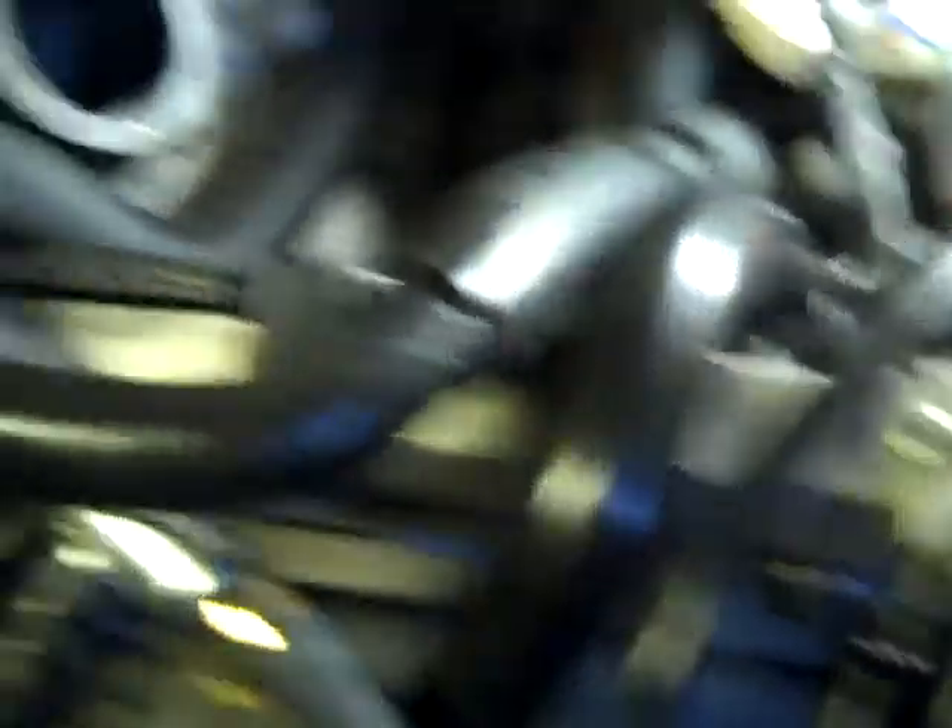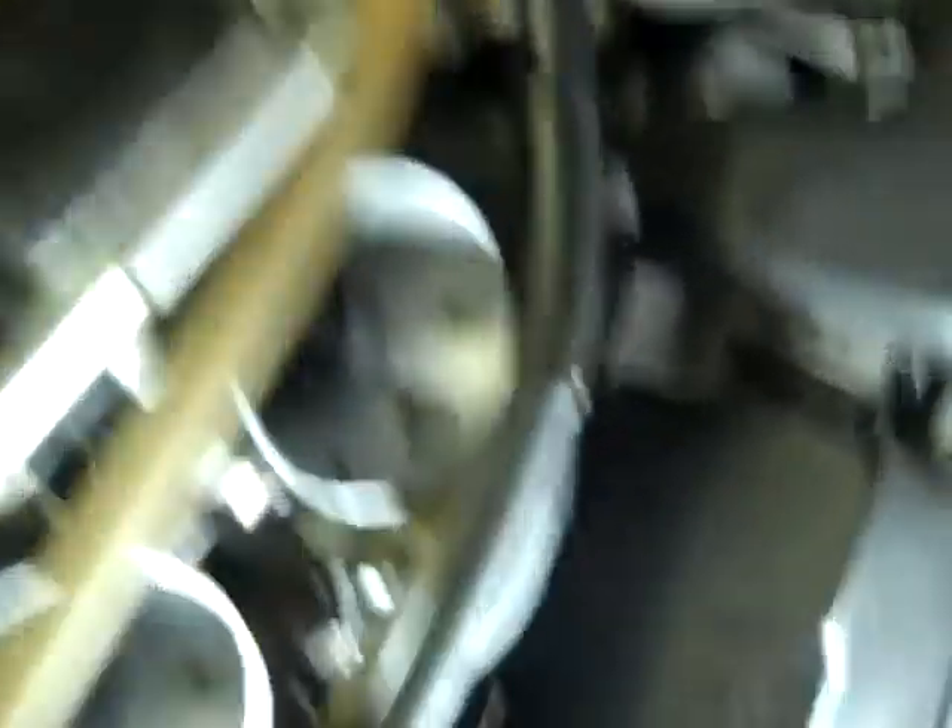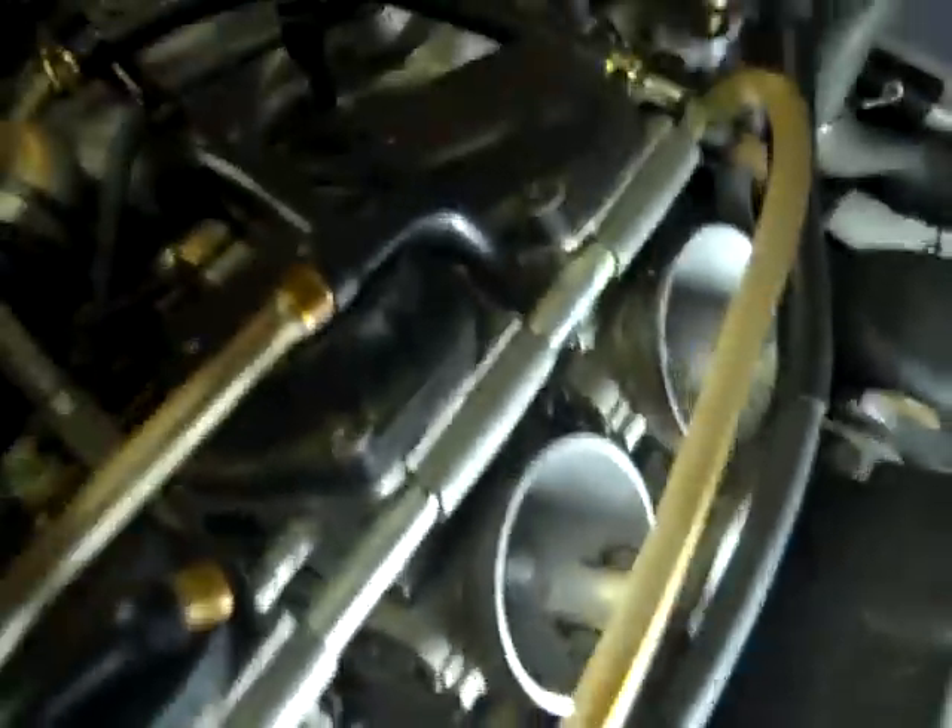Let's see if I can lift them up - yes I can. Under that wire there are a bunch of hoses connected: there's the fuel lines, the intake fuel lines, the throttle cable, and the overflow. Here's the bottom of the carbs right here and that's my next objective - take all those out. I was trying to do that but couldn't quite turn it over because there's a wire tie right here - I'm going to cut this wire tie.